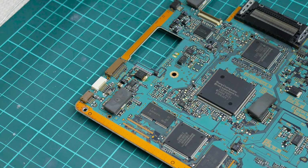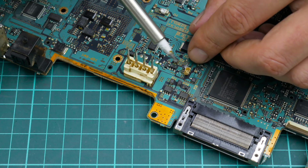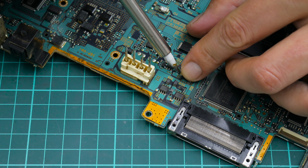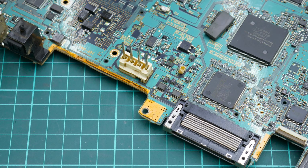And the reason why the cooling fan isn't always working is coming from the connector on the motherboard. The connector was a little bit damaged previously. I mean, it's a little bit desoldered. And when I try to remove the cooling fan, the connector just falls out. Fortunately, the contacts are still good. And this isn't a bigger problem, so the connector can be easily soldered back to the motherboard.